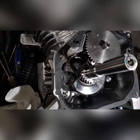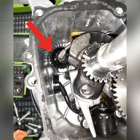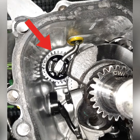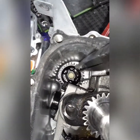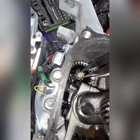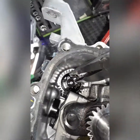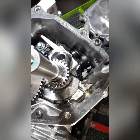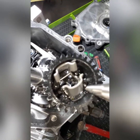My cam popped out with my cover so I had to put it back in there — don't worry about that. All you gotta do is make sure your little dots on the cam match up. Then pull this governor out right here — this little black gear in the back, that's the governor. Then get the other side of the governor arm out of the way. That black gear in the back is what you want to get out — that's the hardest part. You have to get a screwdriver and a hammer to break around the inside ring, which really you're just breaking the whole gear itself anyway. Once you break that, get it out of the way. Make sure you've got your washers and everything's clean — getting all the washers out is probably the hardest part.